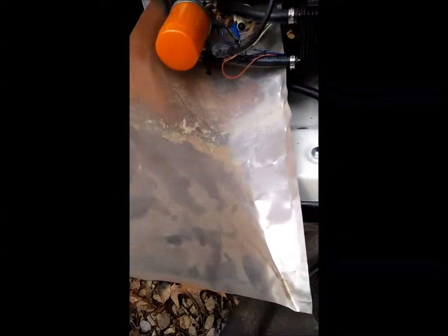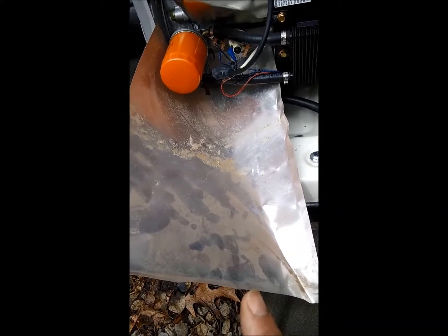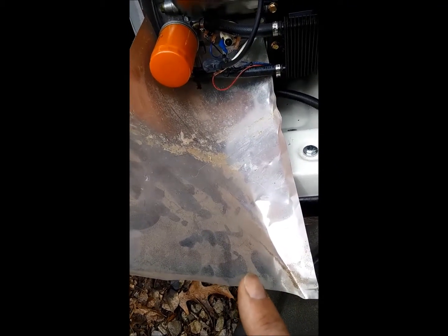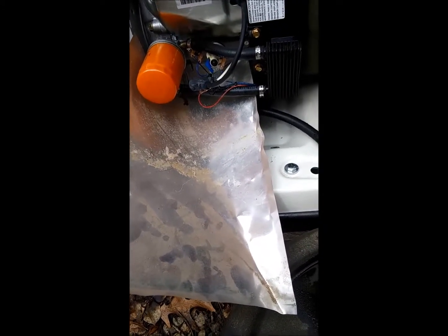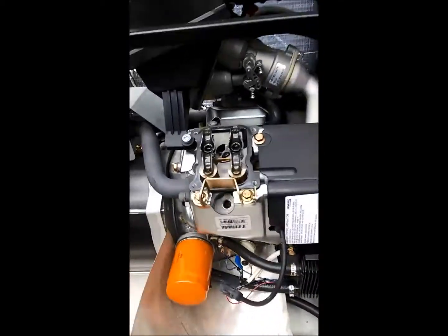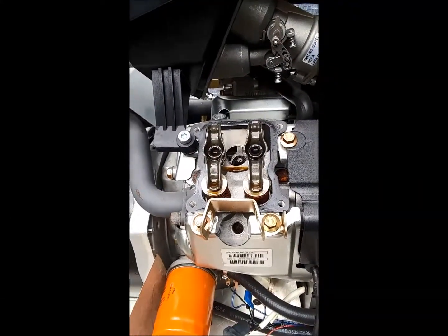While it's draining, I used some rough flashing and made a little trough to catch the oil that's going to drip down from the oil filter, which I loosened. During this drain, go ahead and remove your four ten-millimeter bolts and the valve cover will just come right off.